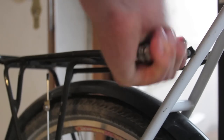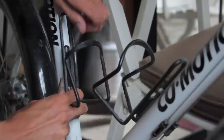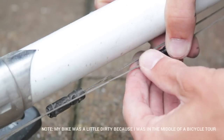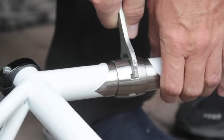In order to travel with the bicycle inside a case of any kind, you first need to remove the bicycle's front and rear racks, water bottle cages, fenders, handlebars, and pedals. Then deflate the air from both tires and unscrew the custom fasteners found on the three main cables that run along the bottom tube of the bicycle.